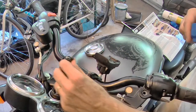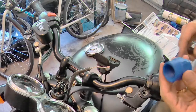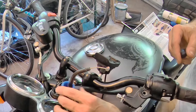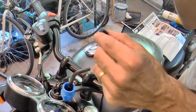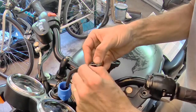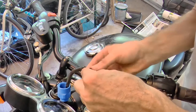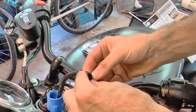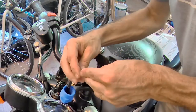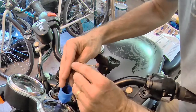You can see that I've taken the clutch cable off of the handle of the lever, so it's sitting loose now. We will try to attach this lubricating device. We take this collar and slip it on the cable. Then the trick is to get this rubber fitting attached, and we want to have it so that it is completely encompassing the cable. So we are going to just twist it on like so. Then we want to get this so that it is not on — it's curled or coiled around the housing of the cable.